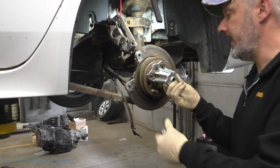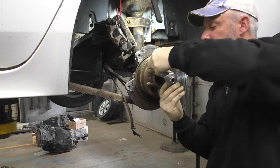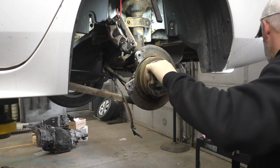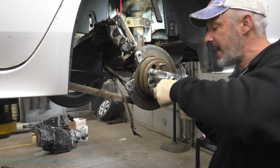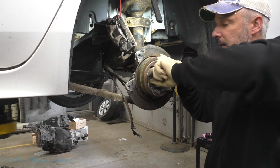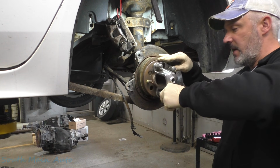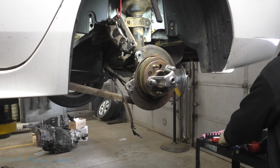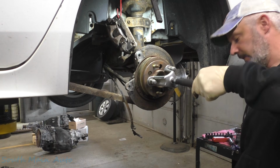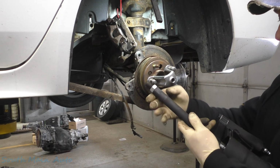We're gonna use the Astro pneumatic air hammer. Mr. Subaru did a video on this pulling off a hub. Of course, he lives in a fantasy world where there's no rust. And it worked wonderfully. I don't suspect it's going to work, in my opinion. I hope I'm wrong, and I hope it works wonderful. But I've wailed enough on a 10-pound slide hammer to know that this probably isn't going to have enough inertia. That's my thought. But we're going to give it a try.